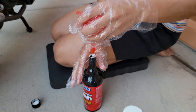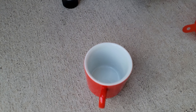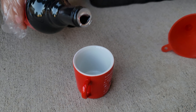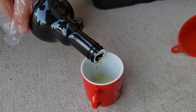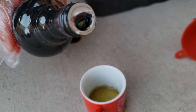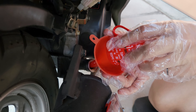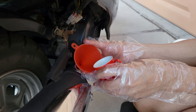We're opening up our bottle of flush. This is like a little thin detergent. Vanessa is going to dump it in here — we're going to be using two ounces — and this is going to circulate and get all the carbon buildup around the rings out. Basically it gets sticky over the years. There's two ounces of flush, and now we're going to dump in a little bit more flush.